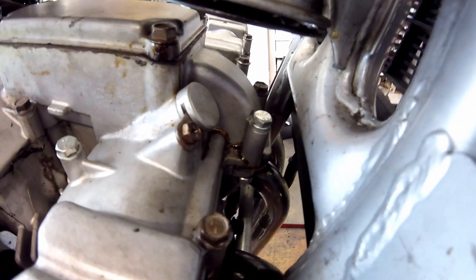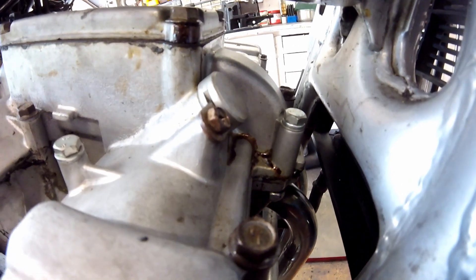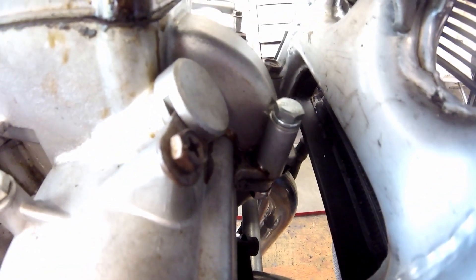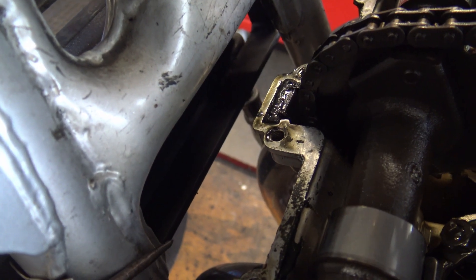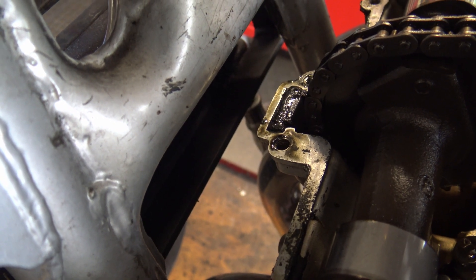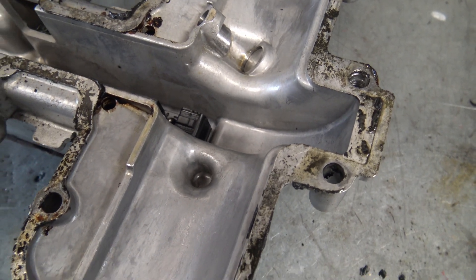The threaded area was open at the bottom so my initial response was to force a longer bolt down through the hole and attach a nut and washers. Wishful thinking had me hoping that the two remaining stripped threads might work until the next service, but within about 100 kilometers or 60 miles the cover was leaking oil badly, necessitating a more robust repair. The bolt holes on both sides at the front of the cam chain tunnel had stripped threads and the pathway the oil was taking to the outside can be clearly seen on the tunnel front and the corresponding position on the cover.